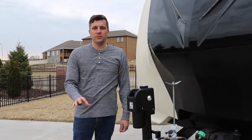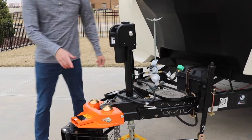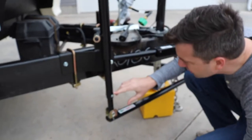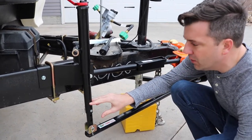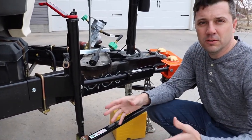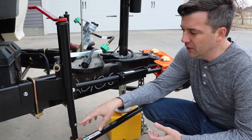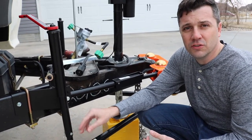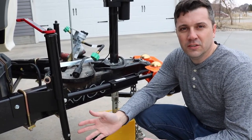Every time you hook the trailer up to your vehicle to tow, make sure and check the tension on that strut assembly, and double check that it is perpendicular with the A-frame. There are three marks on the spring bar jack, and they suggest starting with the middle one. This will stiffen or loosen the ride — middle is middle of the road. If you want it tighter go to the bottom one; for looser, go to the top one. Once on the road you can adjust it as you go.